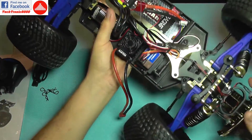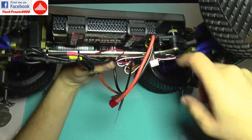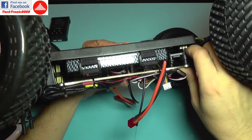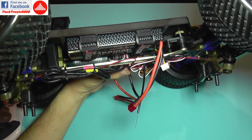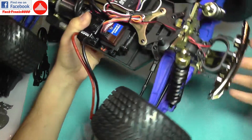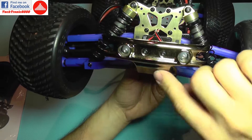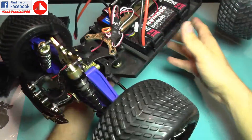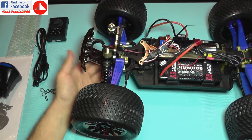On the steering there's a steering servo saver which is adjustable — it has a spring-loaded mechanism. In case you hit a curb or something it will hopefully absorb the impact and save the arms and servo gearing, providing a bit more protection. Sadly the front bumper looks rather nice but is made from plastic. If you hit something it won't save much of the car and won't make it jump over bumps — it will probably just crack away.